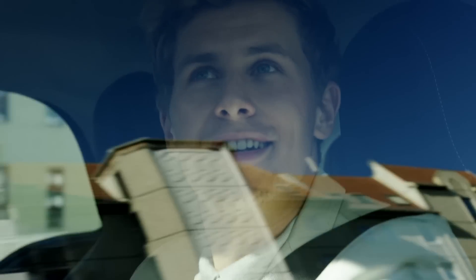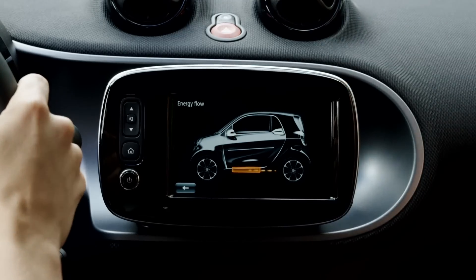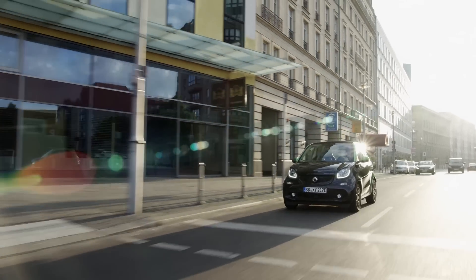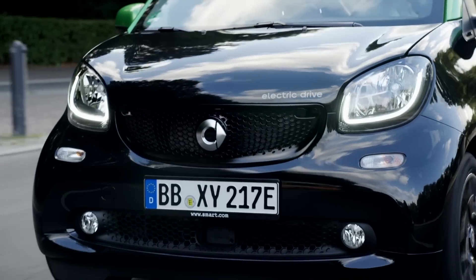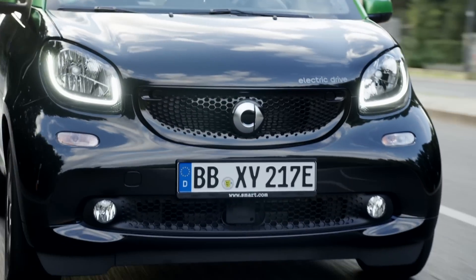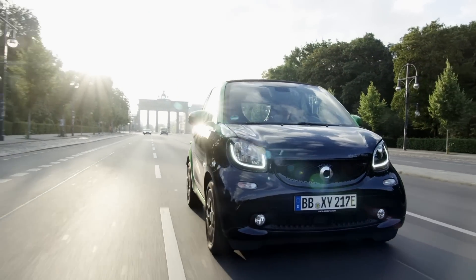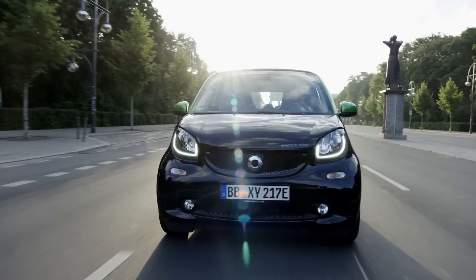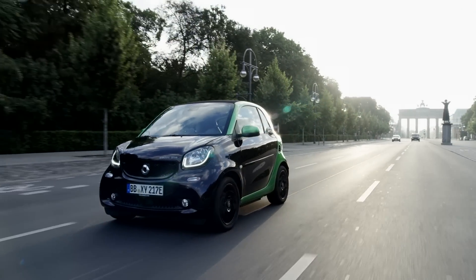Check the pressure on your rubber. Poorly inflated tires can cause around a six percent increase in rolling resistance, and with modern radial tires they can look fully inflated even when the pressure is very low. Not only can this lead to poor handling, it can also significantly impact your range. So make sure you keep your tires fully inflated. Don't rely on the gauges in gas station forecourts — air pumps there can often be wrong, sometimes by a fairly significant amount.